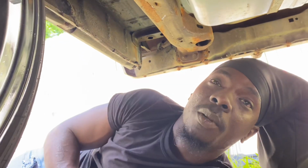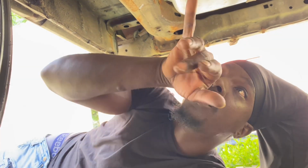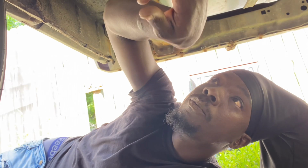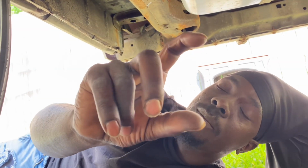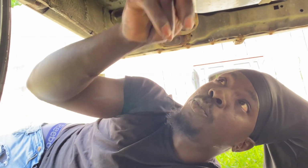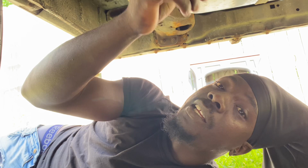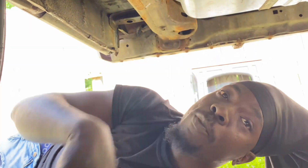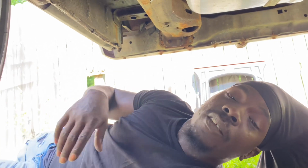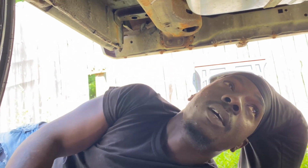it allows you to be able to run an AN6 fitting straight through the tank. Like you drill a hole in the tank, and it's got like a little rod and a screw in it. You put it in there, you tighten the screw up, and then you take the screw out, and then you put your AN fitting inside of that, the little part that goes in the tank. That's hard for me to explain. I had to leave the part in the description below, guys, so you can check that out. But yeah, so